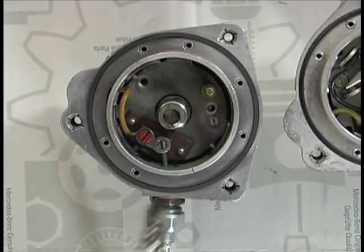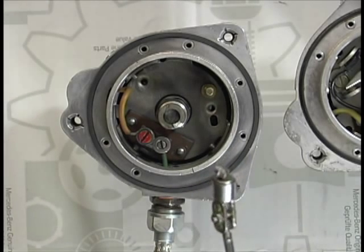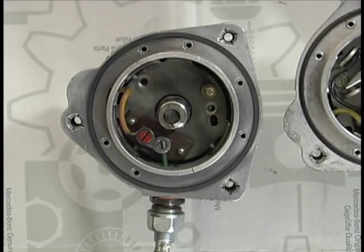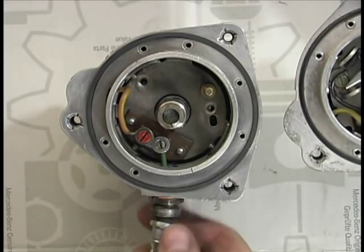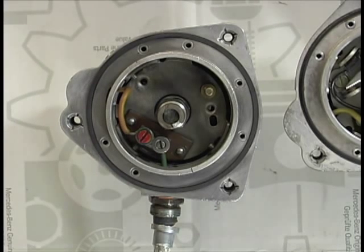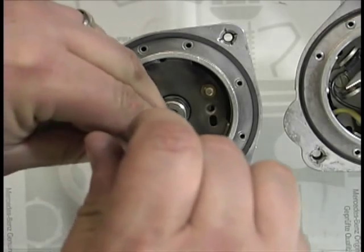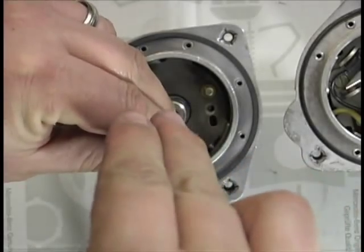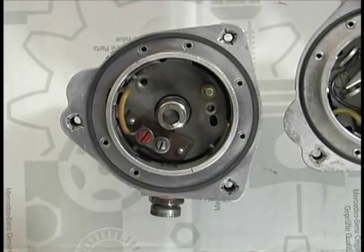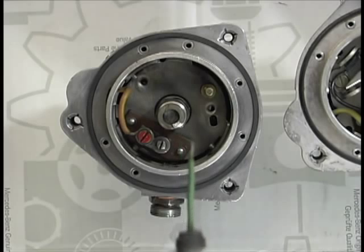You'll want to save these parts and pieces in case you ever have to reinstall them into the distributor if you have a failure. You're going to remove the shielded green wire from the distributor. Loosen it in the set block on the distributor. Make sure that once you remove the wire, you tighten that screw back down, as you do not want it to come loose and fall into the advance mechanism.